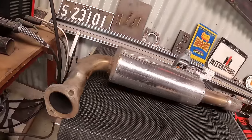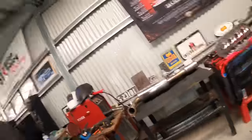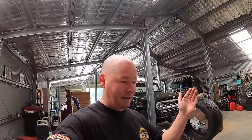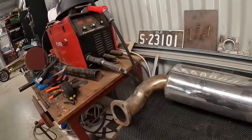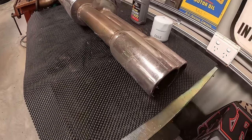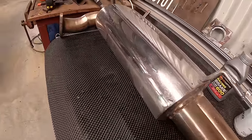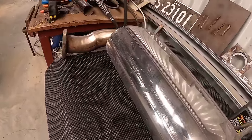The optimum size for a 6-litre platform Commodore, something like this little thing here, is actually a twin 2.5 inch. You don't need a massive big twin 3-inch system, and knock your cats out, and have straight-through mufflers and race pipes and all that sort of stuff. In fact, you can get a fairly basic twin 2.5-inch mandrel bent system — something like this, this is the rear end — and don't knock the inside of your mufflers out, and don't delete your cats.